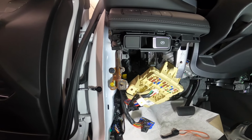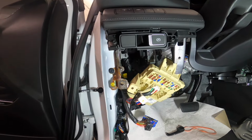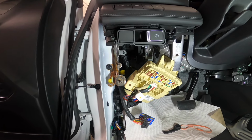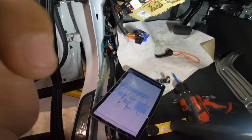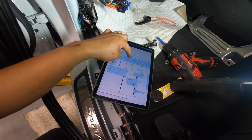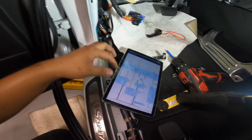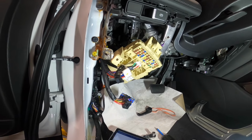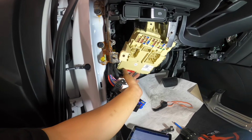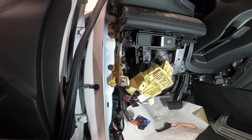We know it's not the hazard switch, right? We know that the signal that goes into the junction box, there's no short to ground there to activate it forcefully, right? Because we checked here. This guy, because I think this hazard switch just wants to see the ground it goes in. Yay, I have ground now. Okay, I'm gonna turn it on. I think that's all it is there. But there's no short to ground in here. But our hazard switch is turning on. I think I'm gonna ask them if they can find another Santa Fe like this. I can quickly swap this junction box and see if it's gonna resolve the problem.